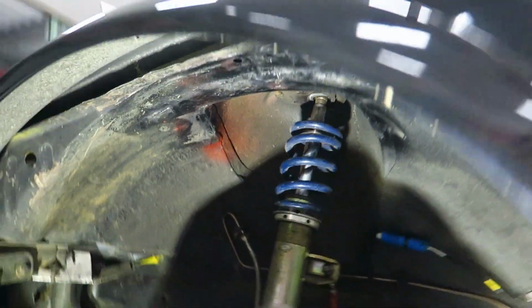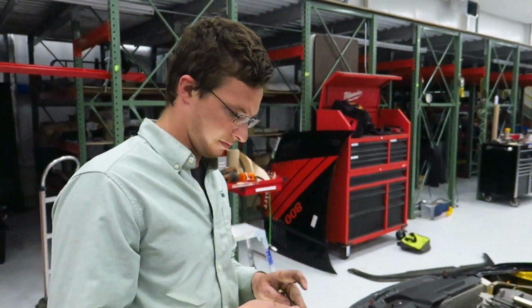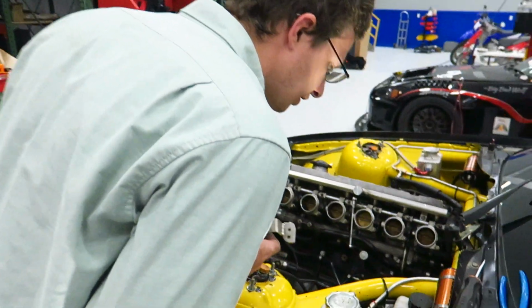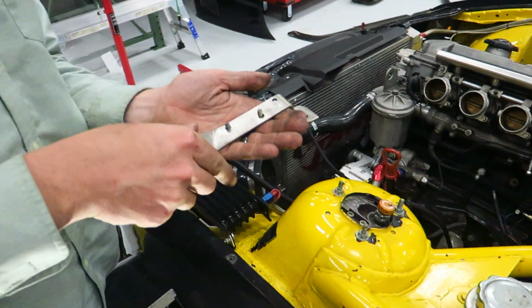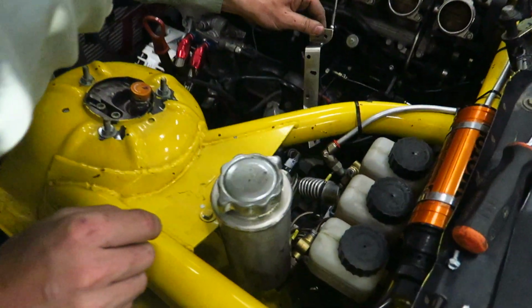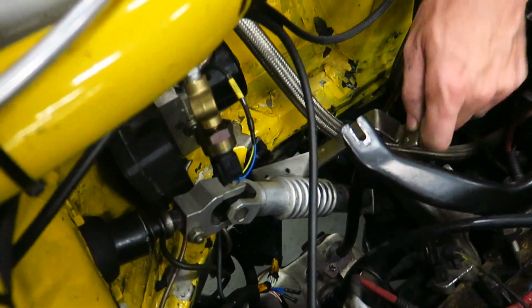We finished doing the wheel well clearancing. Hopefully that'll give us maybe a 1/4 inch more room. Then while inspecting the new ABS pump, realized that this bracket had come loose. So this is the bracket that holds the ABS pump, and it just goes down here underneath of it on the frame. It's tough to get in there, but it seems to have rattled itself loose.